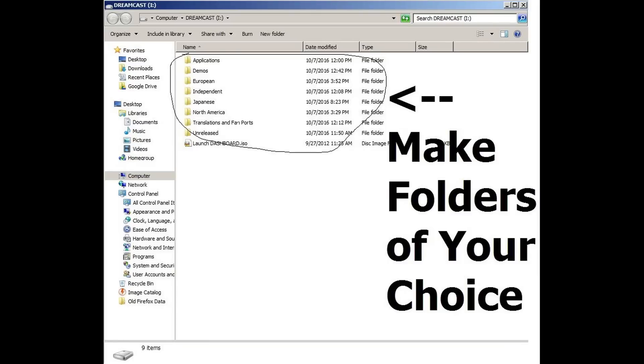Your flash drive or hard drive must be FAT32 formatted. I realize that's kind of inconvenient, but that's what this thing takes — FAT32. FAT32 is obviously a very old format, and a lot of devices like this one-terabyte hard drive — Windows won't format that to FAT32. So you have to get third-party software that will format big devices like this. I found that, got it to work — it was fine. But that is an annoying extra step you have to take. Once you format the thing to FAT32, you drop the ISO file in there. Then you can use whatever folder structure you like to put your games in there. I didn't like the guy's folder structure, so I made my own. At that point, you're pretty much ready to rock. You just connect it to the device here and then you turn it on like you would normally.